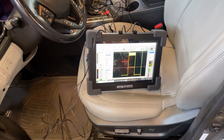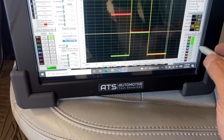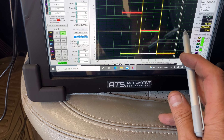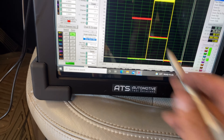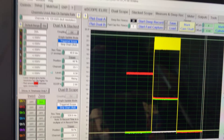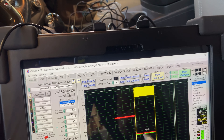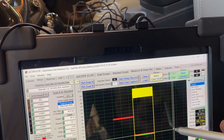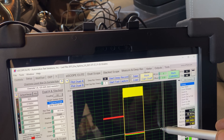I need to figure out what is drawing this much — whether it's our lamp circuit or something else. Let me check the ground as well — the ground looks pretty good. I don't see anything wrong with that ground; the power is definitely dropping. When the high amperage is being consumed, the power is staying at around 8 volts.